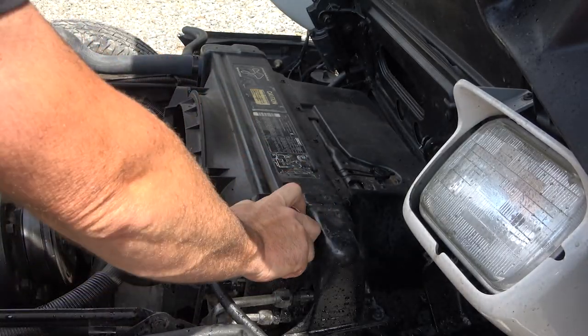So remember, if you've got air in your system and you need to bleed it out, go ahead and turn your heat on so that the heat is circulating through the heater core — you're getting all the air bubbles out of the heater core, out of the engine, and out of the radiator. That's how you do it, and you can do it with any car, side by side, or anything.